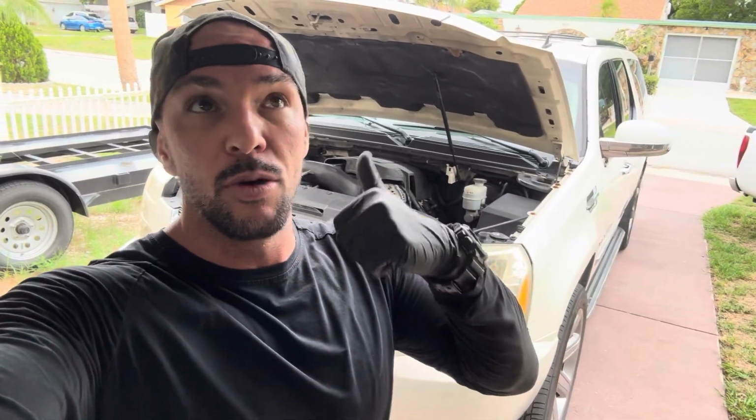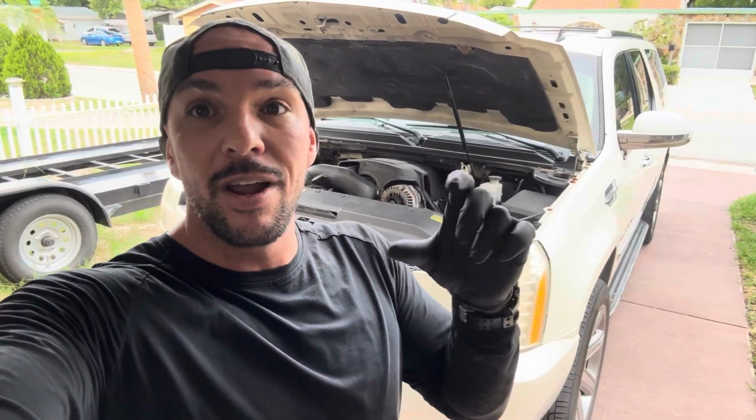And so I started, okay, let me look at the wiring. And so this thing had the typical, or not so typical, I know this is something that not a lot of people know about, but these things will throw O2 sensor codes, crank sensor codes, camshaft sensor codes, and there's wire loom that goes, especially in the all-wheel drives, along the drive shaft down below. It eats through there, and then it messes with the 5-volt feedback circuit on that.